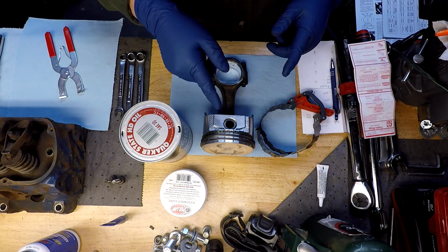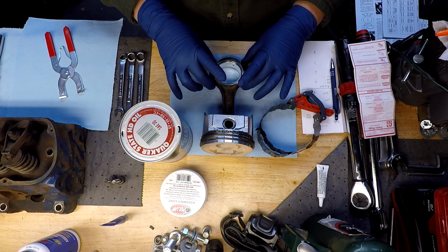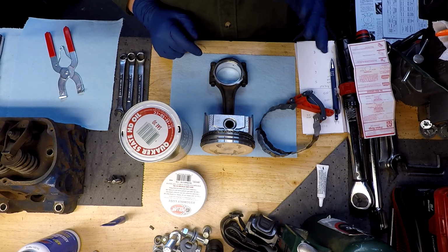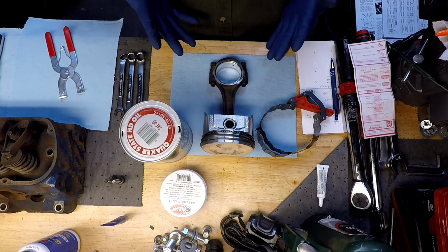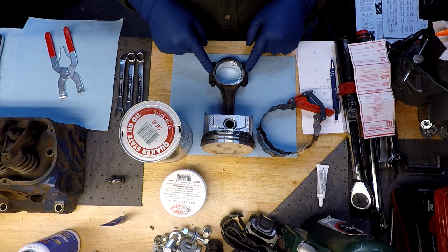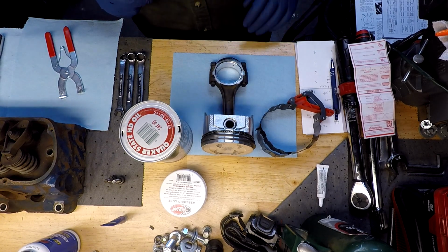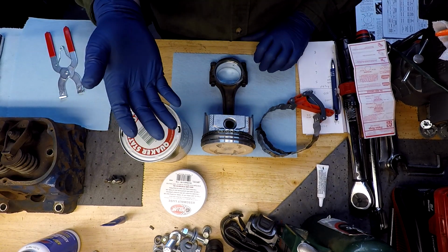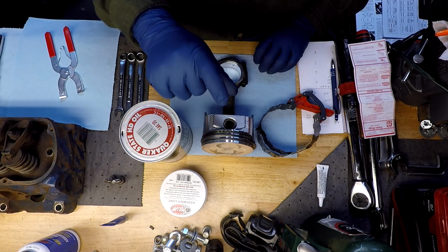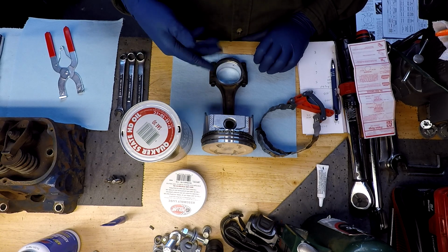But hopefully with that oil in the cylinder and everything should slide in. Keep an eye on our rod bolts here, make sure we don't accidentally run into the crankshaft and nick it or hurt it. I think I got some little pieces of rubber that I'll have on the ends of this to make sure it doesn't accidentally scratch anything. You don't have to be fancy with it. Cleveite used to send out little bolt caps, just little flat ones. It would fit on anything.